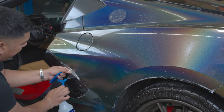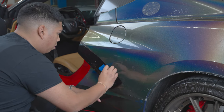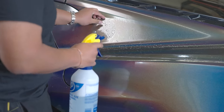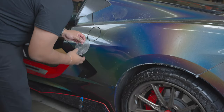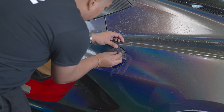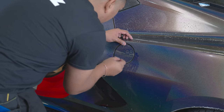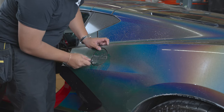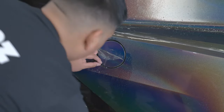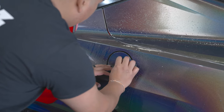Focus on the bottom edge. Grab our slip solution and pick up the gas cap. Peel that back, spray your slip solution, and make sure your gas cap is nice and centered. Hold it from the top edge, peel that back up halfway, spray your tack solution, and let that film just fall in place. Grab your squeegee and go ahead and lock that down. Pick the top edge back up, spray that half with tack solution, and squeegee all that out.